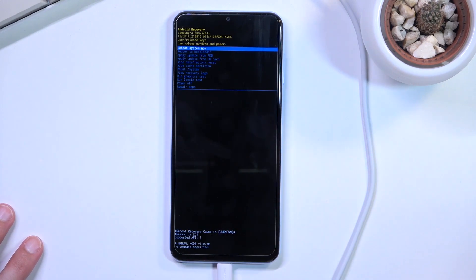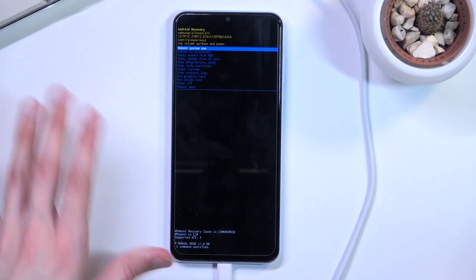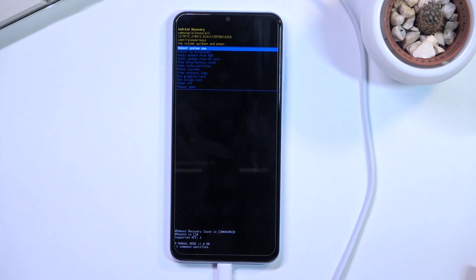Or, if you wait a little bit too long, it will show you a charging status and you need to wait until it actually shows you the exact percentage. Once you see the exact percentage the screen dims out a little bit, so you can then start holding it. Once you see the little circle with charging, holding power key and volume up will not get you anywhere — you just need to wait, or like I mentioned, do it before it shows up.